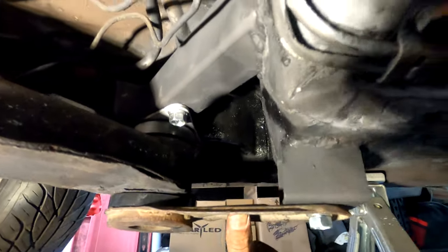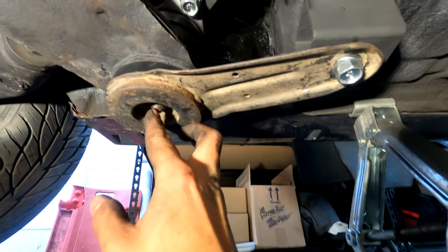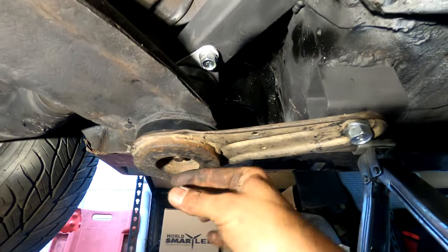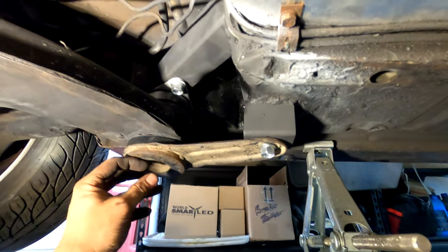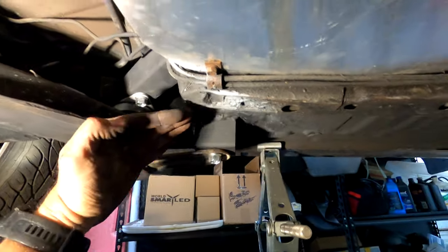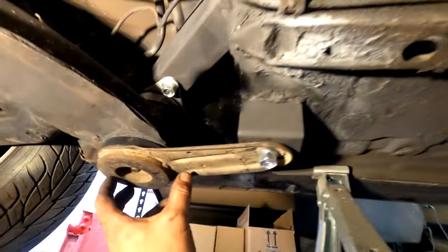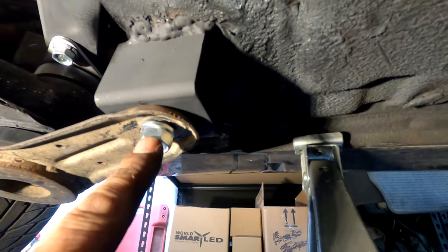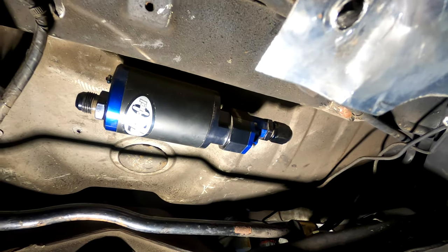We're done — it's sitting on its own, everything's perfect. This bottom brace is nice and parallel with everything else, and the chassis bar is going to come down maybe an inch and run all the way to the front control arm mounting point. I might have to work it up a little depending on how low it really is. I'll probably stick a nut on the back side — bolt and nut to hold that in. It did tap all right but we'll see.